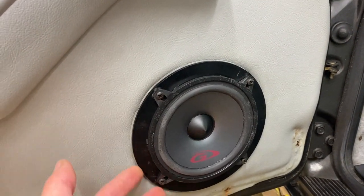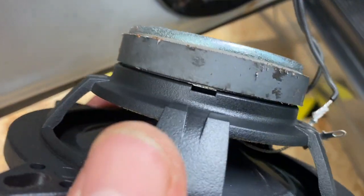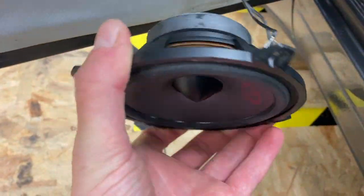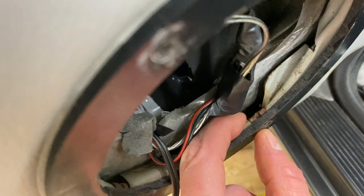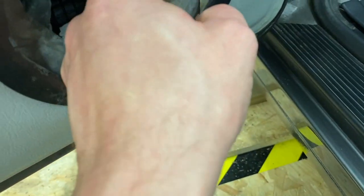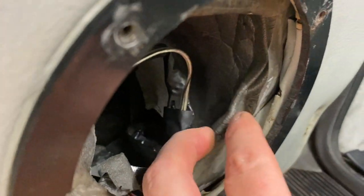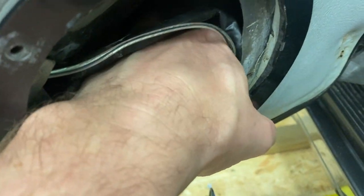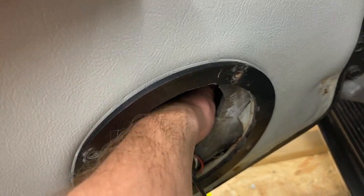We'll improve this — I'll show you later; we'll 3D print some mounts that bolt directly to the metal. The speaker is unscrewed — at least it's soldered on so those connections won't come away easily, but there's no heat shrink or covering, so exposed to the elements. You can see the little speed clip in the back — that's all the screw was going through, nothing actually anchoring it to the metal of the door. And actually, that must be the crossover in there — yeah, the crossover just wedged down in there, and if it's anything like the sub it won't be fixed — yes, I can feel it moving.